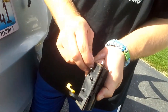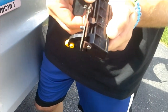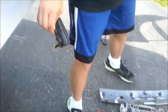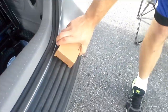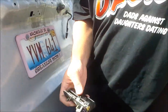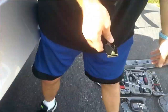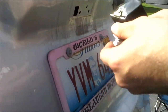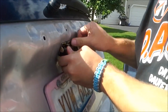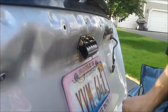We're going to pull this off — there it goes, and it comes out like that. Now you can see what the problem is: this spring right in there has actually broken because it's so rusted. I think they designed this thing to rust this way because they put a rubber grommet on it to separate it from the chassis, so they wanted this to rust and it wound up failing. Now we're going to take our replacement part — the OEM part from Kia is about $125 but this was $39 and it's the same exact thing. Put it in like this, line up the screws, push it in a little harder, and now we've got a functioning handle again.